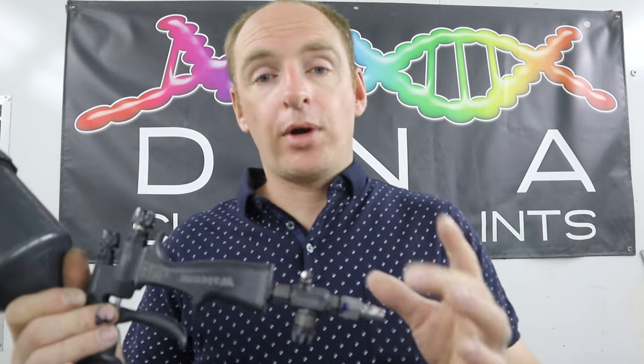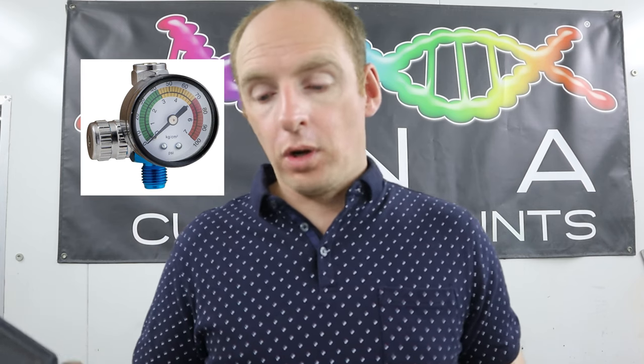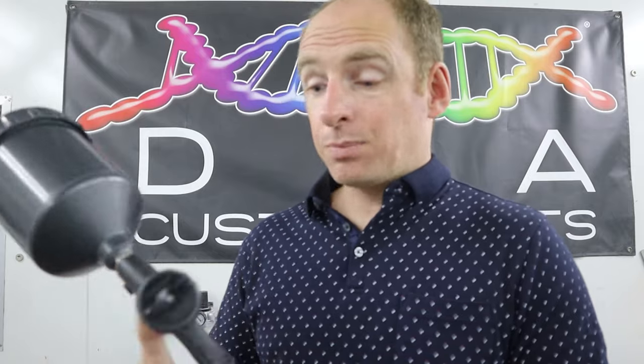Speaking about air pressures — they are all based on the technical data sheets of the products I paint. Generally every brand of paint is pretty much the same in regards to air pressures. Base coat is usually applied between 15 and 20 PSI, and clear coats are usually two bar of air pressure or 29 PSI. Those air pressures never change. You can see what air pressures you're running by using the air regulator on the spray gun — I'll put a picture up on screen of what that looks like.